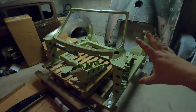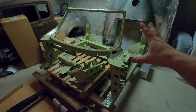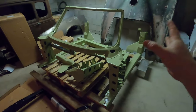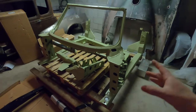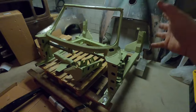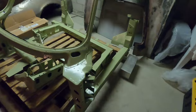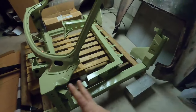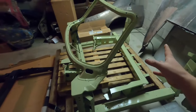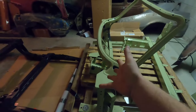In my opinion the best way to diagnose a project car and check on its health is first to know what the birdcage looks like, so it'll help you pinpoint where you're looking for problem areas. This is a 65 convertible birdcage — it doesn't have any fiberglass on it, so this is a perfect candidate to give you some ideas of where to look. Before you get into the birdcage, get an idea of the car's history: where is it from, where did it spend most of its life, and how long has it been off the road?